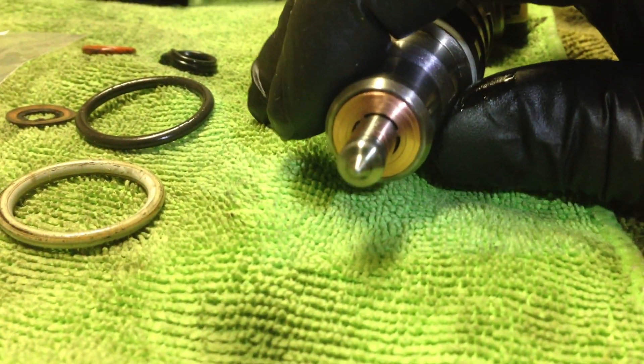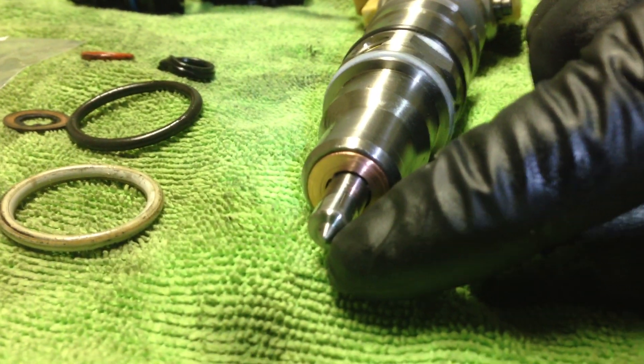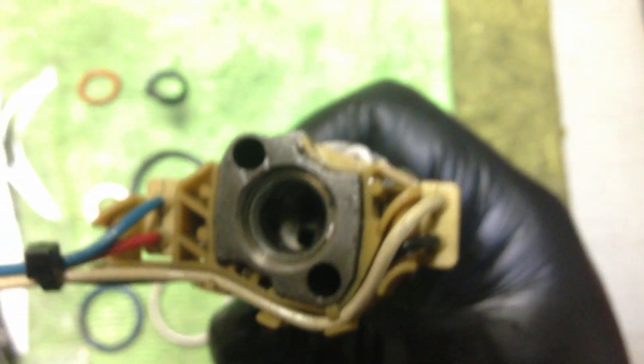The camera kind of cleaned it up a little, now you can kind of see it better. It's got very, very tiny pinholes where the diesel comes out, and if they're clogged up like this one is — you can kind of see the little mountains of soot built up around the pinhole — and the o-rings are extremely flat and worn away. That's the number one problem, which nobody wants to tell you. They just want to tell you that you've got to go buy injectors for a freaking o-ring.